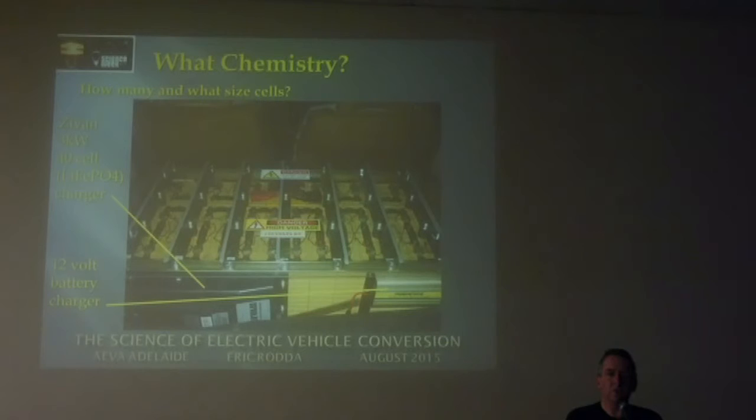Because when you're crawling, your current, in my car particularly, can be around 5 or 6 amps if you just crawl along the side of the road. But when you're driving at 50 k's, it might be 60 amps. So there's a big difference between driving fast and driving slow. You could crawl home as long as the alarm didn't come back on. Then when you get home, you've got to find out which cell it was and possibly replace it. If all the others still have high voltage on them and it's not near the end of the range of the car, that cell's faulty.